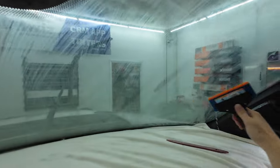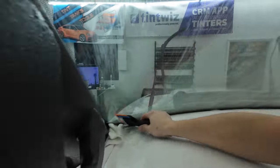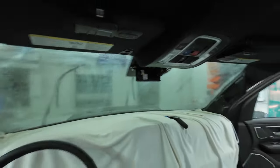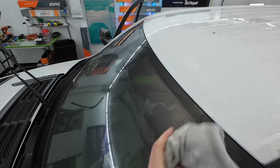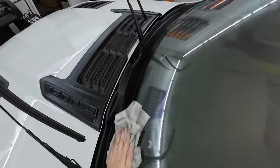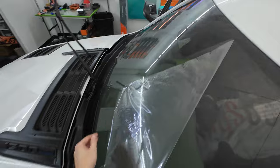The reverse roll method. Last pass there. To clean off the outside, I've been taking these towels — these are really good. You can either squeegee off the outside or take a lint-free type towel and clean up all the edges. That's going to be the main thing. While you were shrinking, you have residue from the dryer sheet on the edges, and I just want to make sure those are all cleaned up as much as possible. Now we're going to go ahead and peel this — I like to peel it in quarters. We'll peel it straight across.